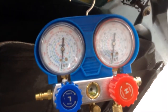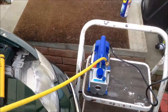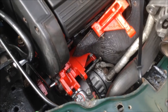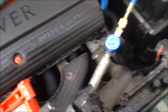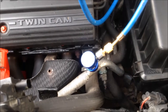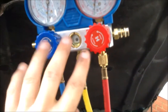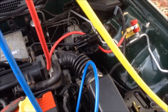As you can see by the gauges, we are now pulling a vacuum. It's just a case of waiting for the vacuum pump to pull a vacuum for a period of time and then hoping it holds. One important tip: switch the vacuum pump on and let it pull a vacuum up to your manifold with the manifold valves off first, then turn both manifold valves on so the vacuum pulls down the two lines. If it's still holding vacuum at that point, there's no leaking on your manifold.